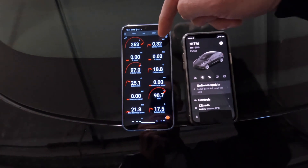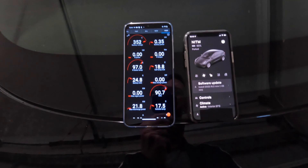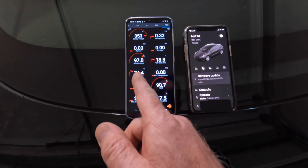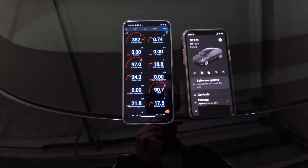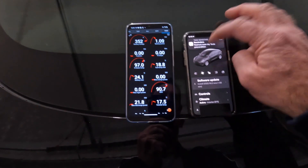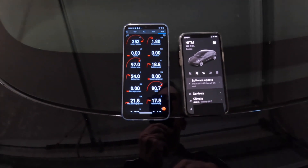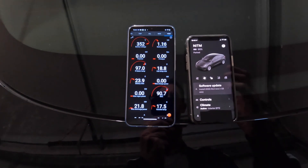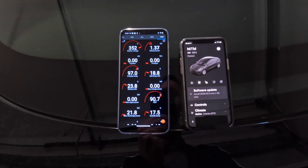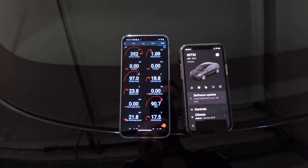You can see that's backed right off to about 300 watts — it's really only just running the fans and the computer inside the car at the moment. It's not really trying to heat the battery up that fast. It's going to be sharing the heat from inside the cabin and circulating that out through to the battery to share that heat. Part of the efficiency is — if the cabin's warm, it's going to share that warmth with the battery and won't need to use the heat pump to heat the battery as often.